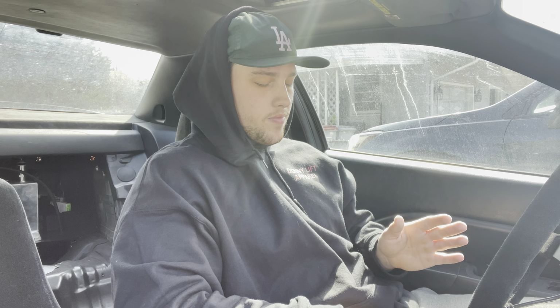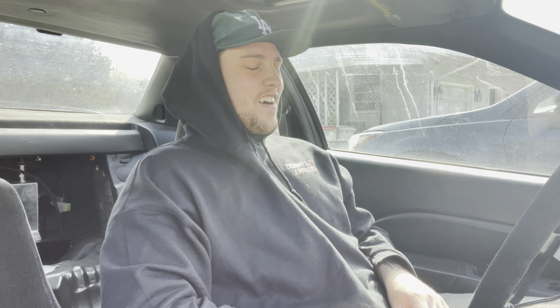The battery's dead because the alternator's not keeping up because I put more electrical load on the car. I got giant fuel pumps, gauges, other relays, giant fuel injectors, and a couple other things. Even though I got rid of a whole bunch of stuff, the load of the new stuff is way bigger than the stuff I got rid of. Anyways, I digress.